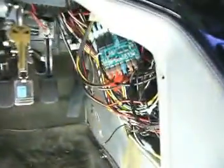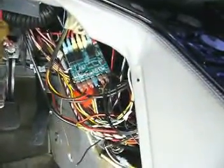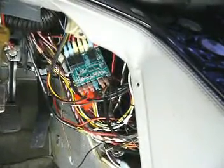This controller offloads the high currents from the ignition switch and also provides a push button start — a true push button start where once the engine is started, the button is disabled. It can't crash the starter gears.